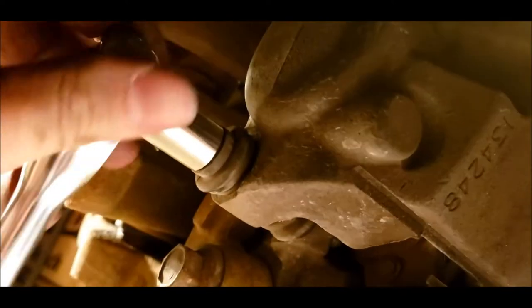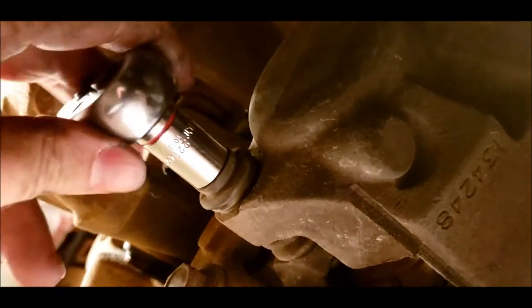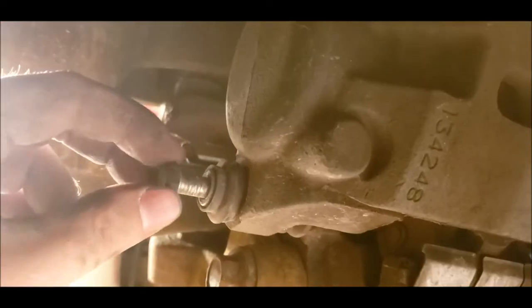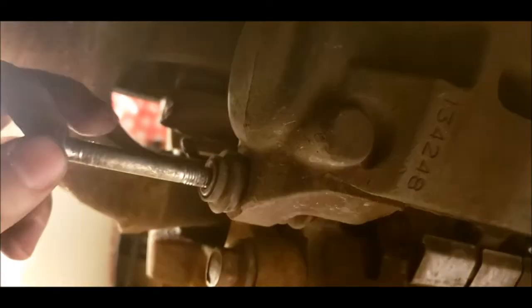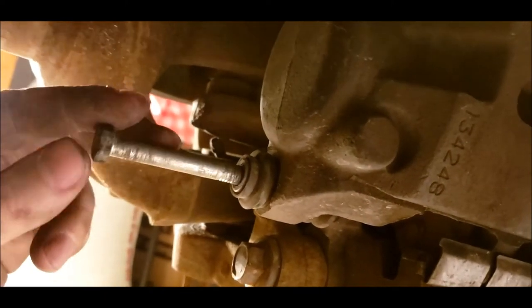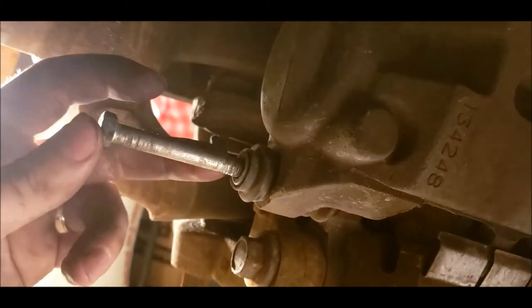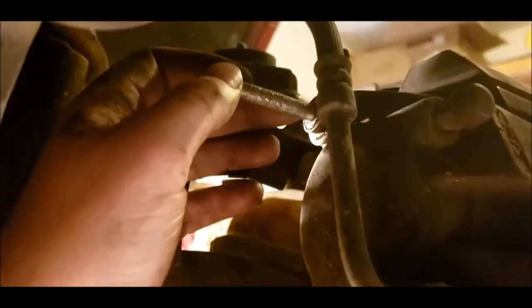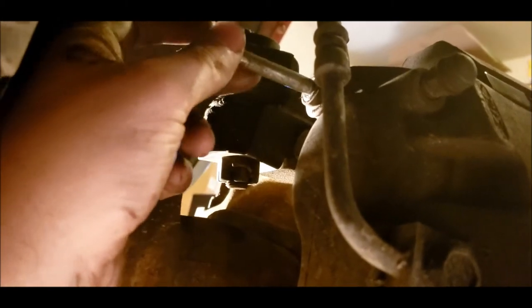So this is a half-inch socket. I'm just going to take this off - it's not on there very tight, so you can just bring it on out. Once you can pull these out, you can check right here and feel if you need to replace them. Mine have a little bit of lube on it but it's gritty, so I can tell there's rust and dirt in there. It should be real nice and smooth. This one as well has some grease on it, but it's gritty, so I'm going to go ahead and replace them.